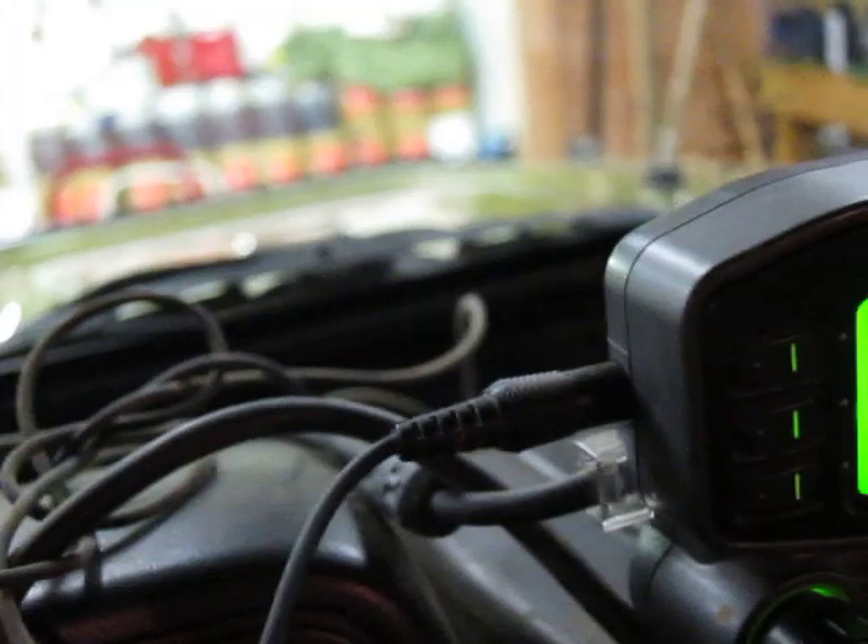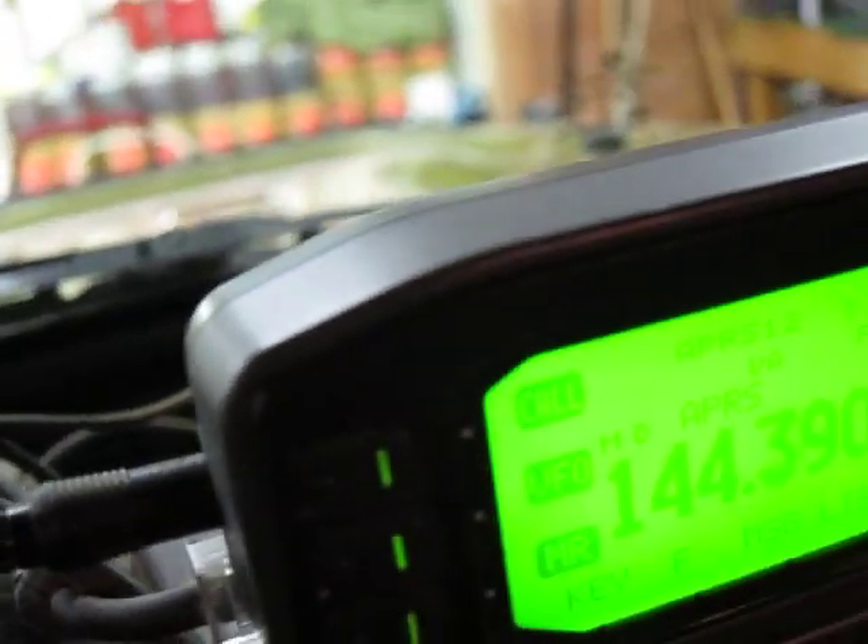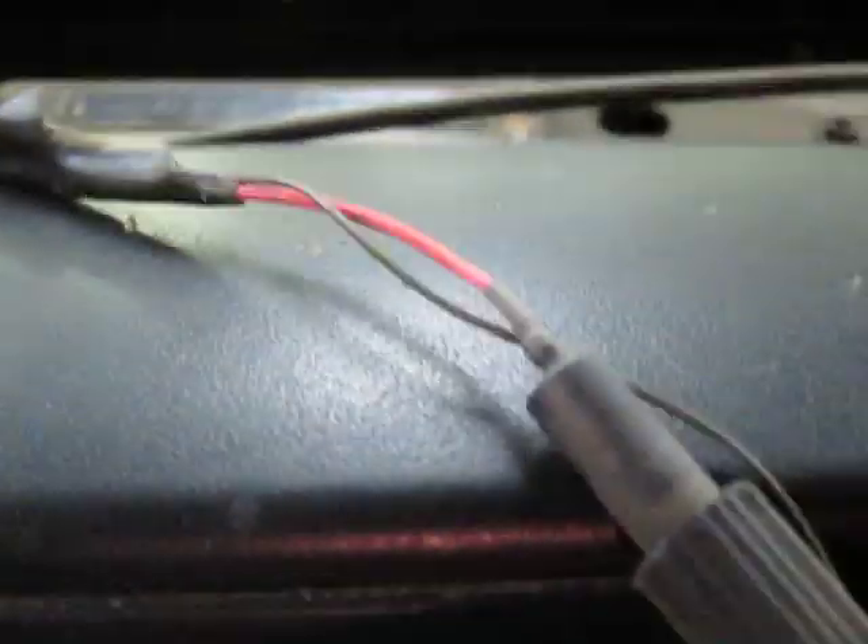The first thing you need to do is make sure your cable is set up properly. You'll notice that there are five wires that are going to come out of your Garmin cable that you purchased. Two of them, the black and red, will go to your fuse setup. This will be necessary for your power, and the nice thing is that when you plug it in your 400T will just power on without going to mass storage mode. The other three wires are used for your data and grounding.